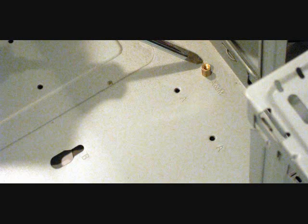Before a motherboard can be securely placed into a bare-bones system, the standoffs need to be inserted in the matching locations of the screw holes on your motherboard. In this picture is an example of a standoff screwed into the case. These are what allow the motherboard to be attached to the case. If this is a new computer case, these should have been included with the case.